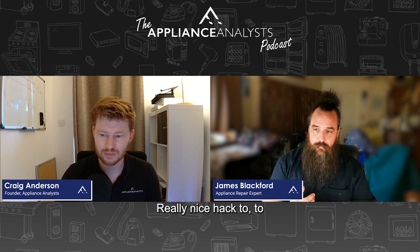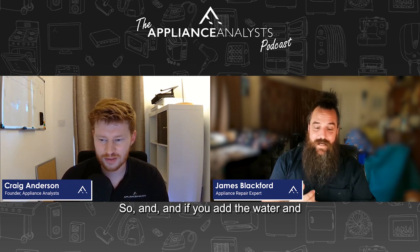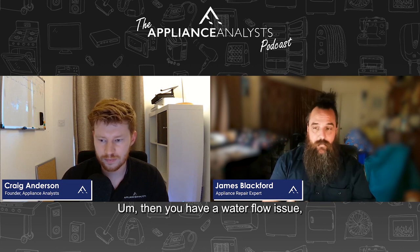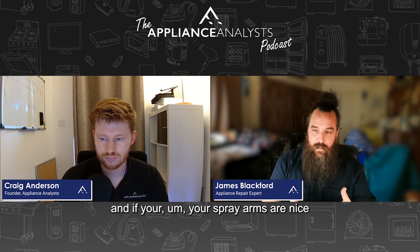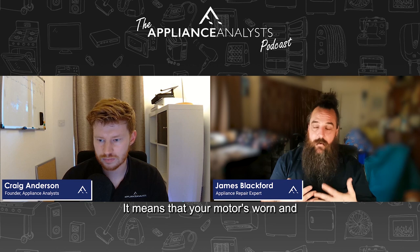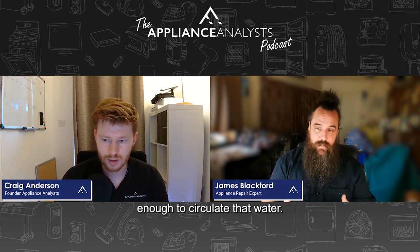Right, yeah. Really nice hack to sort of figure that one out. Yeah, for sure. And if you add the water and it's still not dissolving the pod, then you have a water flow issue. And if your spray arms are nice and clear, your filter's nice and clear, it means that your motor's worn and it's just not able to function good enough to circulate that water.